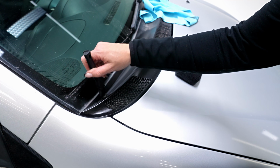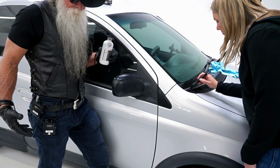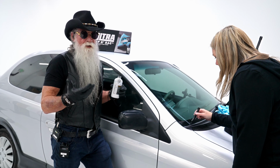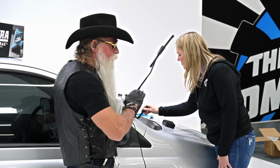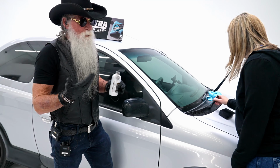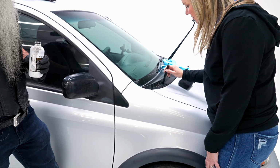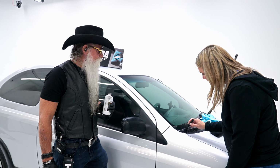And with Solution Finish, more is not better. If you do your whole vehicle, put the cap back on, take your towel, and it is totally black, then that's how much you're losing. So when you apply it, put on a small amount, apply it to the part, and keep going until nothing else is going on the part. Then redip it. That way you're not only saving Solution Finish, but you're not wasting time and effort that you don't need to. This is nice because you can get it down into the inside of those holes. Yeah, and it's soft enough to be able to do that.